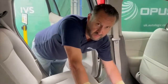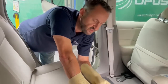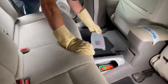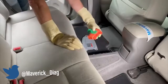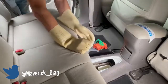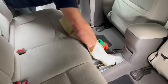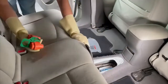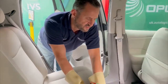Next, we're going to isolate the battery pack. What this actually does is it splits the battery pack in half effectively in the vehicle, so you shouldn't have any DC current at the battery. On the Nissan Leaf, it's between the seats under the cover here — I've already removed the cover. We're going to pull the isolator out. I'm going to put some tape over the hole while we're operating on the vehicle, removing the battery pack, so no one interferes and puts the plug back in. I'm also going to remove the plug and put it somewhere safe, then leave the vehicle for about 25 minutes to see if it fully discharges.